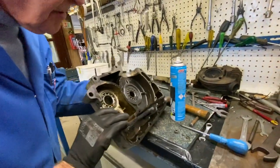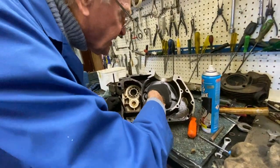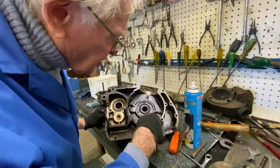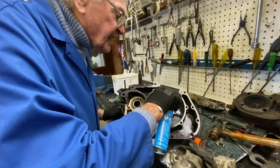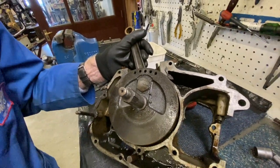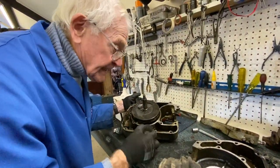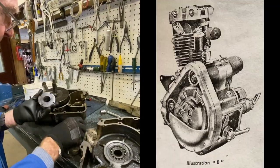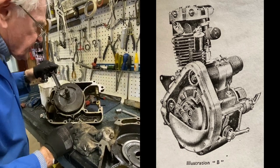Anyway, let's let go. So, oh, not good. Bit grim really, isn't it? The sleeve gear bearing doesn't feel too bad, but I'm not very keen on all that metal sludge. The flywheels have been rubbing on the side of the crankcases. It's buffed away the nut on the side of the big end. So that's where all the crud comes from. So that's probably why the big end's gone and the small end, because all the bits of metal flying around ain't good for an engine.